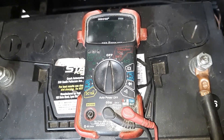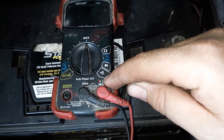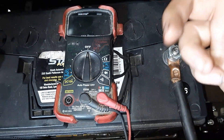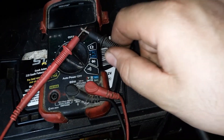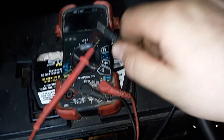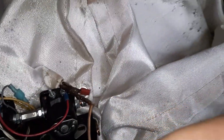This is a very convenient tool to have. If you don't have one, you should probably get one. The one I suggest getting - get one with that little continuity symbol right there. You can also use ohms, they're kind of the same, but that one beeps. I got this one from the parts store - it was like ten bucks. What you want to do: put it on that little symbol there. It's called continuity. When you put those two leads together, it'll beep - that basically tells you the circuit is complete, the loop is complete. So you get power coming in, it goes through there, to the next component, through that one, to your pump. And that is how you can trace down what is bad in a setup. If you're losing power somewhere, usually it's your solenoids - eight or nine times out of ten. Could be a bad battery, could be a bad motor, could be a bad switch. But you can use this on pretty much any of those scenarios.